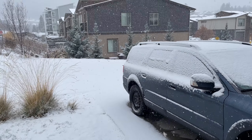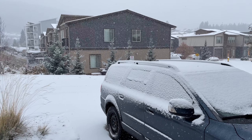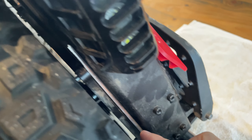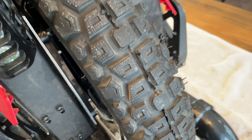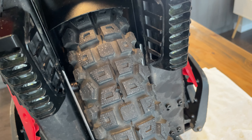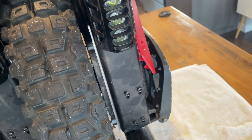I'm sorry I can't get any riding footage — it's the extra slippery fall-on-your-face kind of wet snow outside. So as soon as this melts, I will have some footage and I'll report back. I'm quite certain I know where the rubbing sound is coming from — where the C-channel goes down and the sliders are in there, it's making little metal flakes on my tire. I talked to Matt and he said his did the exact same thing for the first couple of days and then it went away. It's just working itself in because that CNC slider is probably a tight tolerance and the metal is soft. I can confirm that his S22 didn't have any of that grinding sound, so I have good faith it'll keep getting smoother.